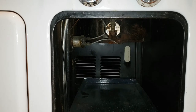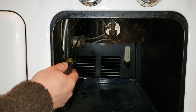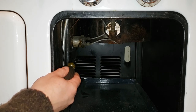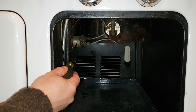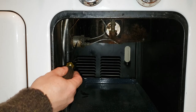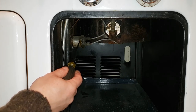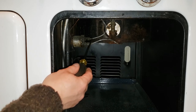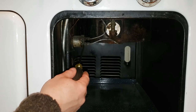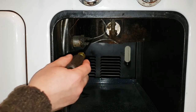To adjust the height, open up the service pantry door and you'll see this. This is the pilot filter. The pilot filter really is just a lot of stuff — sometimes it's cotton, sometimes it's like a steel wool material to catch flakes of the cast iron pipes they used to use for gas lines. It's really not necessary. The parts that are important are these two screws. The top screw follows this line up towards the stovetop pilot. The bottom screw controls how much gas flows through this tube that goes to the thermowell.